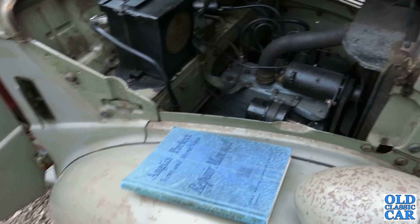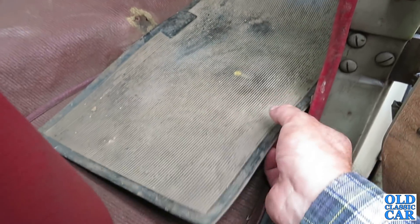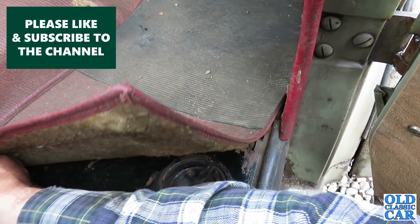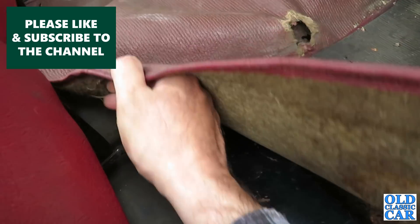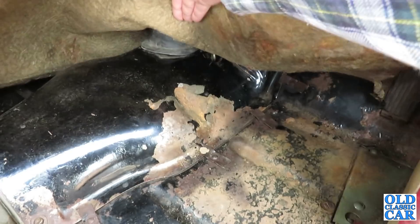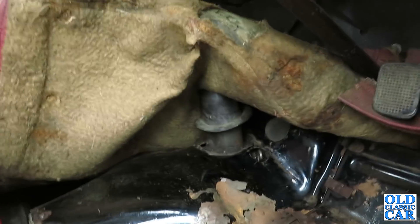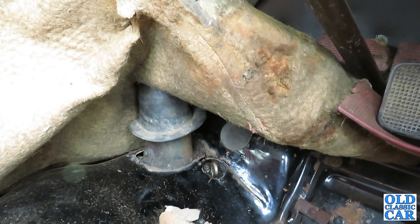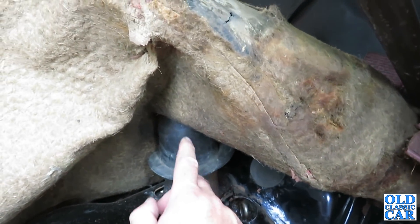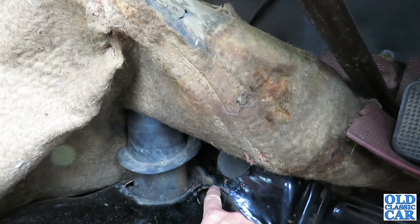I've rolled it outside now because that makes it a lot easier to swing the door open and ferret around in here with the door nice and wide. Let's take this mat out — carefully, because after however many years it is, they're not going to be as flexible as they were when new. There are two ways to fill up the gearbox on a Ford Anglia, Pop 103E, or any of these little side-valve Fords. You can either fill up through the dipstick hole, or you can take the gear lever off. As we're not in a great rush, I'll find a funnel and fill it up through the dipstick hole.